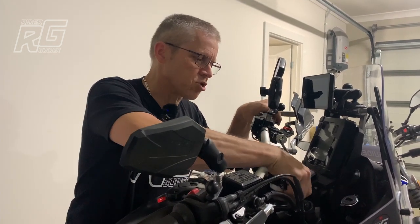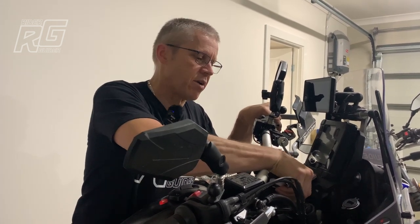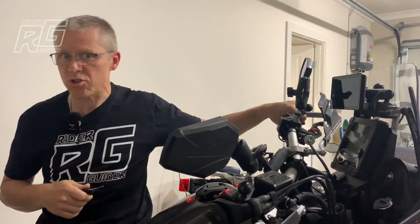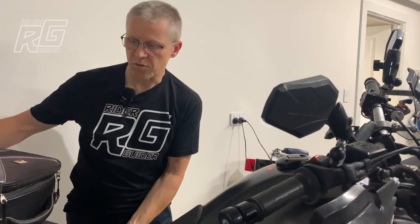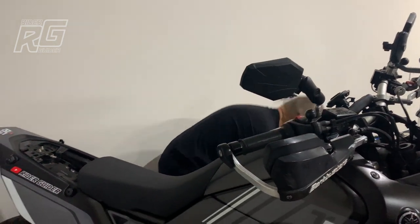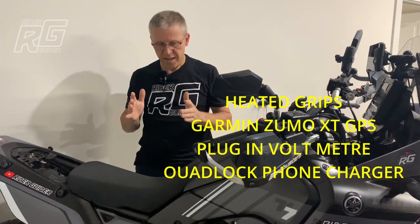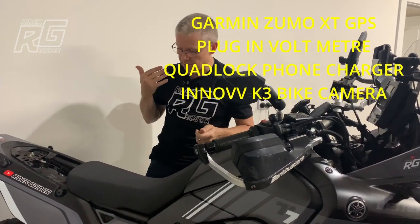Of course, I'm trying the ignition, nothing. Right. So that suggests I've either got a completely dud battery or it's done exactly what it's supposed to do. Have we got to a stage now? Because I am, of course, running a few items which could have caused it to drop its voltage enough for the anti-gravity restart circuitry to kick in. Easy for me to say.